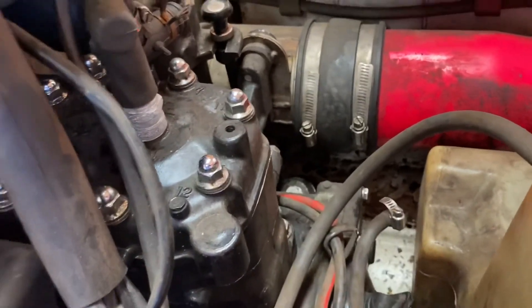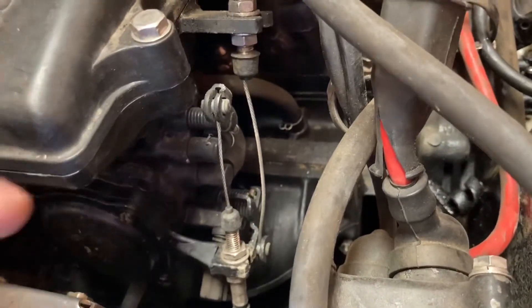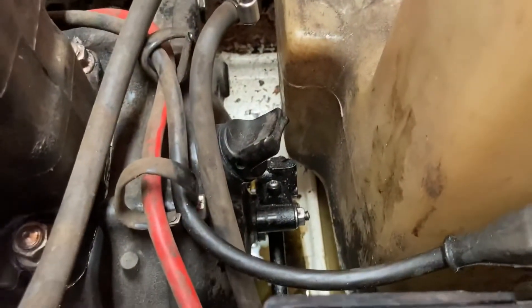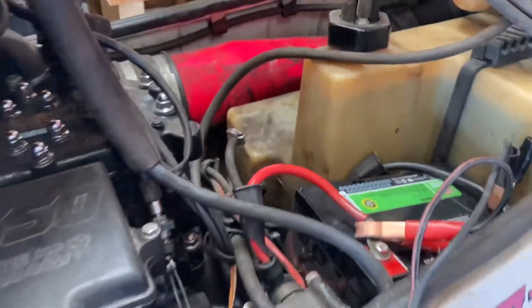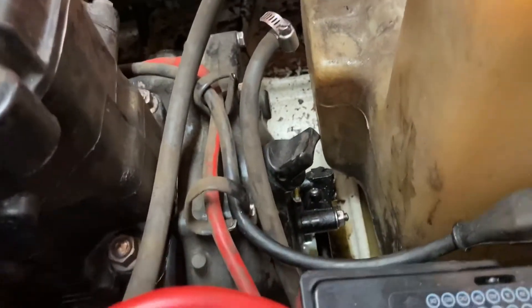It ran great before. I really don't know about the oil pump — it's making me wonder if I need to plug up the vacuum port on the front. I don't know if that can pull air and make it run lean. I've read some things saying if this little plug drain leaks it can make them run lean, but I'm not that familiar with these.